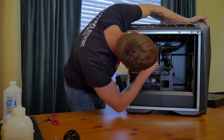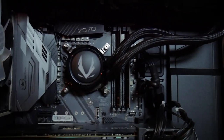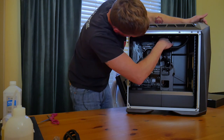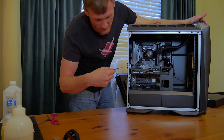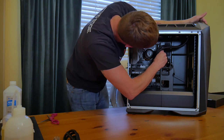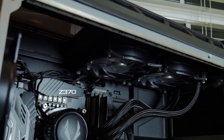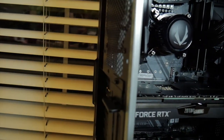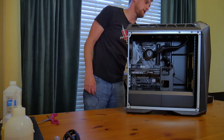This is cool. I don't know actually what AIO this is, but there's an 8700K in here. It's a Z370 motherboard — which Z370 exactly, I'm going to have to look it up. The memory comes shipped with two sticks — so unlike Walmart, you get two sticks — and it's DDR4 clocked at 3200 megahertz, 8 gigs per stick, so 16 gigabytes total in this system. I've never actually seen this all-in-one either, but it has Zotac branding on it. It does seem to pick up fingerprints and grease pretty easily. It has the Zotac GPU in here with a 2×8-pin connector — I don't even know which GPU this is because the branding on the box didn't say.